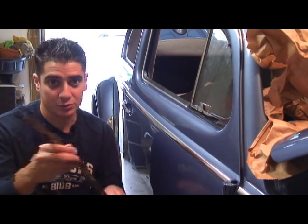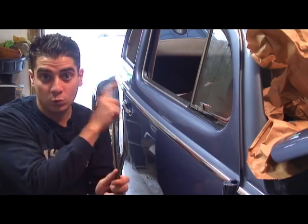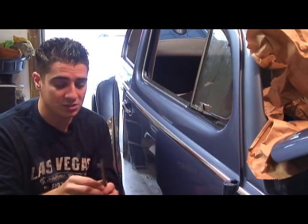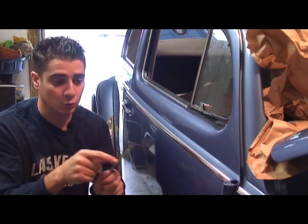I was crimping the wire, getting pliers, trying to shape and form it — it just made matters worse and I wound up scratching the car, which is a whole other ordeal. So when you get new rubber seals — inside window scrapers for your door — make sure you save the old wire, clean it off even if it's a little rusty, take the new wire out of the new scraper, put the old wire through the new rubber, and that'll save you a lot of headache.